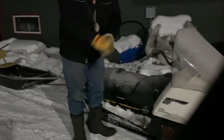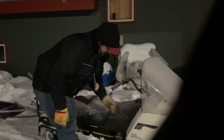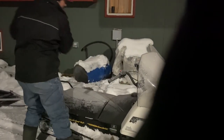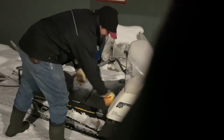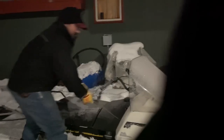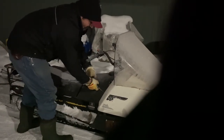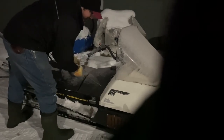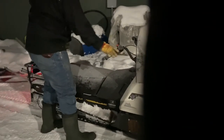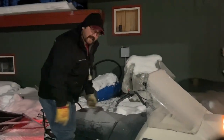Here's how I start a cold snow machine. It's not super cold today, probably like 15 degrees. Leave the switch off, cycle the recoil a little bit, make sure you got as much rope wrapped up in it as you can, and turn it over a few times. Don't just rip on the rope - get it engaged. Then turn it on and give it four primes - that's what I've settled on.